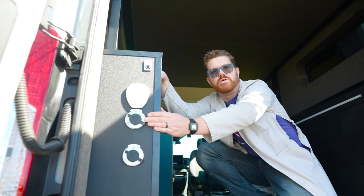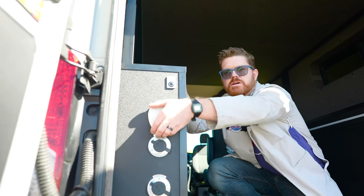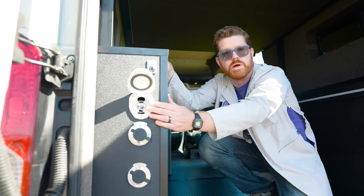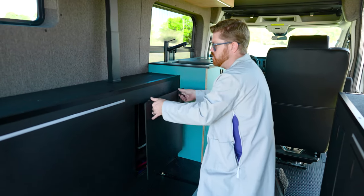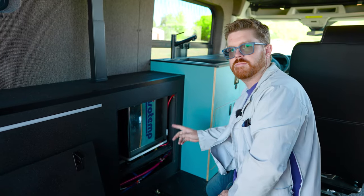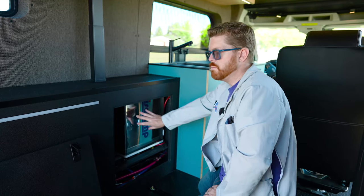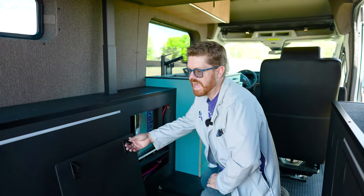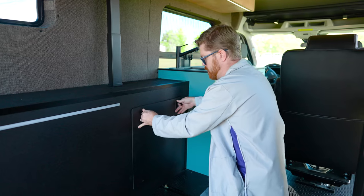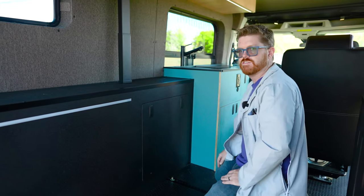Above that we have a freshwater tap with an AquaHose bib so we can rinse off bikes or take a warm shower — we added a hot water mixer so we can mix hot and cold for a nice warm water rinse at the back of the van. I want to point out the hot water heater: this Iso Temp 4.2-gallon hot tank is connected to the coolant system of the Ford Transit — a $65 option from Ford — so every time we drive the van we're making hot water for our showers. We use hatches instead of hinged doors in the cargo areas because hatches can pull out with only a couple of inches of clearance, allowing much easier access to the utilities.